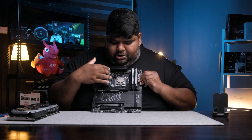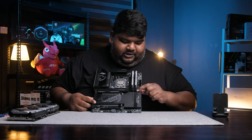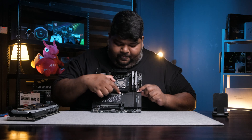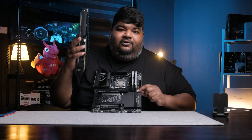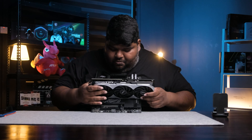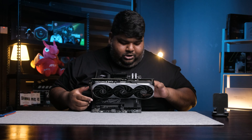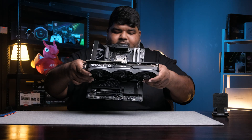Here is the motherboard and the first GPU slot. Just below the RAM on the right, there is a switch. This switch operates a spring-loaded mechanism to grant you easy access for graphics cards. With the switch in its open position, I'm now locking it — you can see it engage. Now I press the switch and it releases. The graphics card comes off easily.